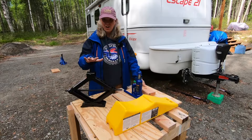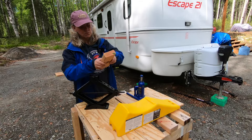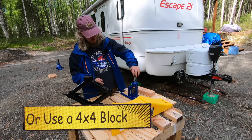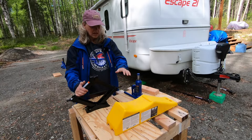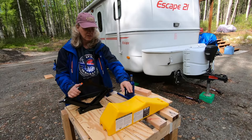What's my final opinion? These all actually worked pretty well. The bottle jack worked great, but there was a little divot I had drilled in the board, and it was pretty soft — it really dug in quite a bit. So you might want to use a really heavy piece of rubber to protect the frame from the ridges. But it did work great. I really liked using the scissor jack from the truck, and if I have to do two tires again in the future, that's probably what I'll use — it's handy in the truck. The trailer aid is perfect if you have a flat on the road, even if you have to change both tires. It's definitely the go-to if you have a single tire to change.